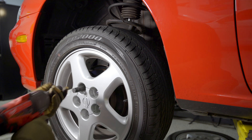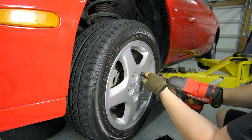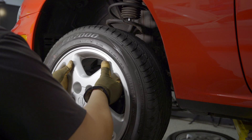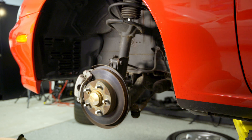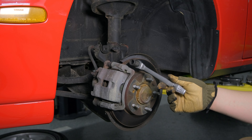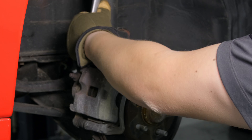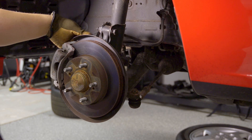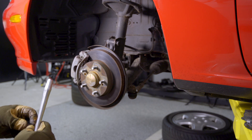Let's go ahead and take off our lug nuts. We've got a rotor — looks pretty smooth. Got our caliper and our brake pads, and the brake pads look like OEM Nissan green ones. We're going to start with a 14mm socket on the back of the bolt that holds the caliper to the knuckle bracket. We take this bolt out and save it so that we can wash it.